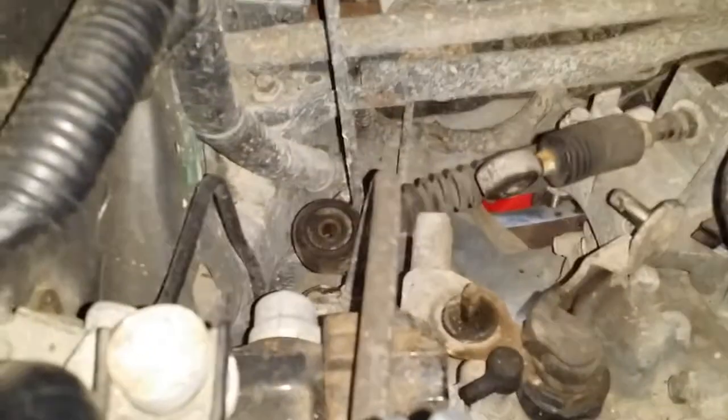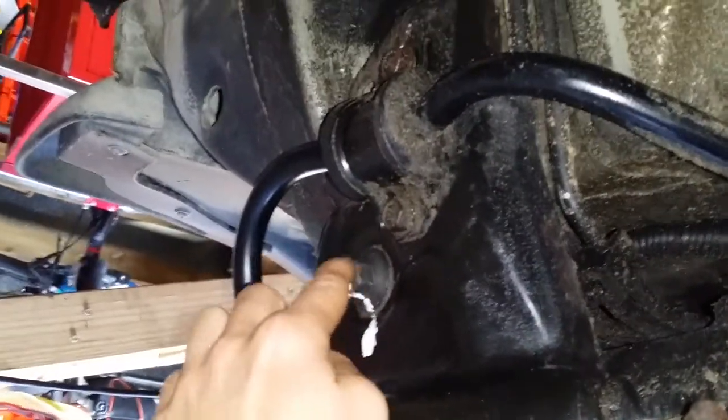There are two bolts in the back of the subframe — here's one of the rear subframe bolts; you have to do both sides. There are marks on the rear subframe right in front of the sway bar that you have to mark and reinstall in the same spot — probably for centering. According to the Helms manual, one is 14mm and the other is 10mm in shank diameter, with torque specs of around 40-something foot-pounds and 71 foot-pounds respectively, though I'm not entirely sure about that.